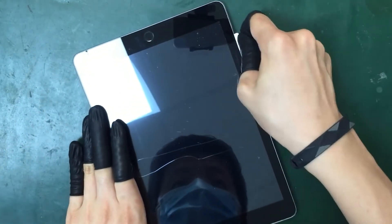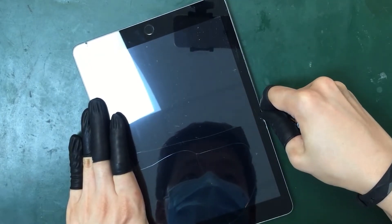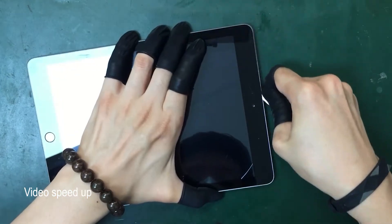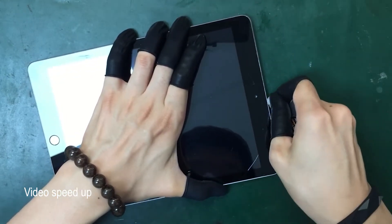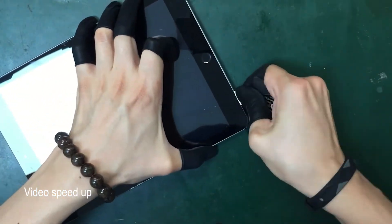Go ahead and round the corners. Don't work too fast. The biggest part with this is just fatiguing the adhesive and working at getting the adhesive loose. And the thing is, you don't need to use a lot of alcohol or anything like that on these — it will cause damage to the LCD most likely.